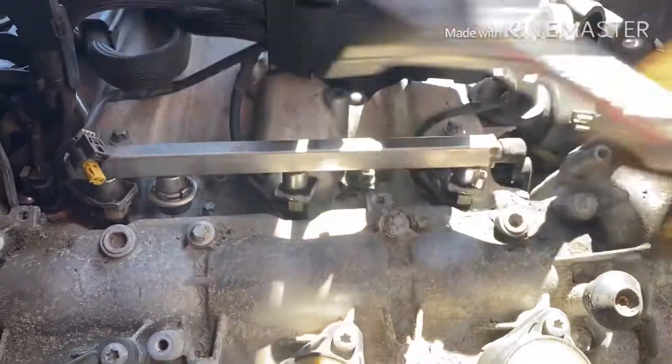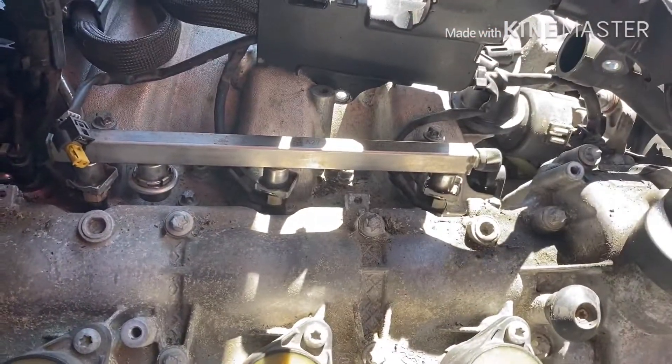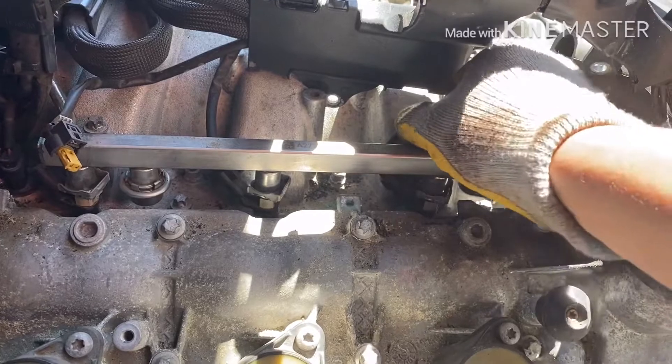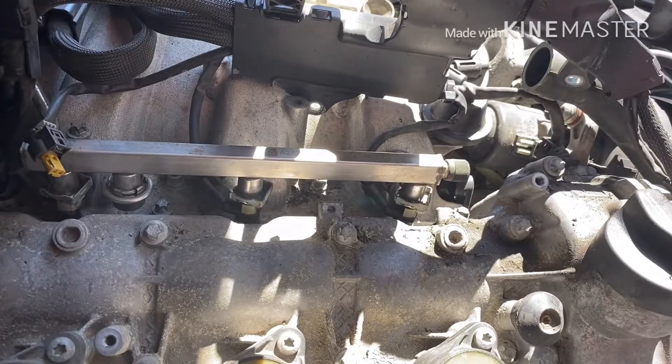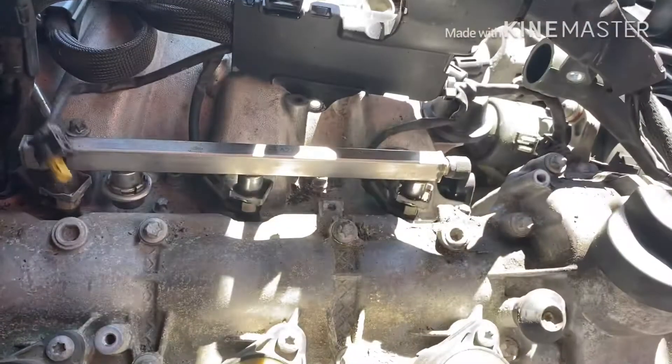Be careful — don't work the fuel line when the engine is hot. Let the engine be cold first. Because when you take the fuel line, gasoline is going to spray a little bit. It might spray onto the manifold when it's hot, and I don't want the engine to catch fire. The best thing to do is just wait till the engine is cold. It's dangerous.